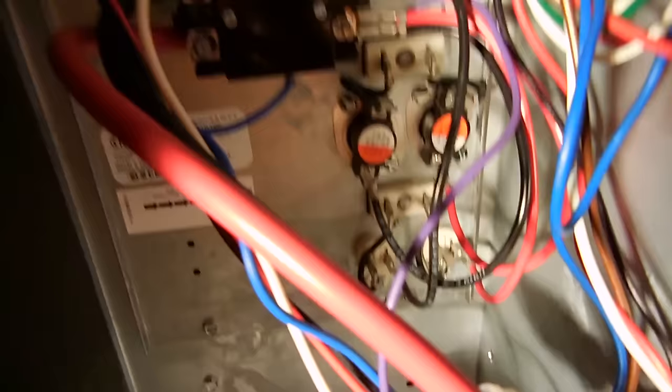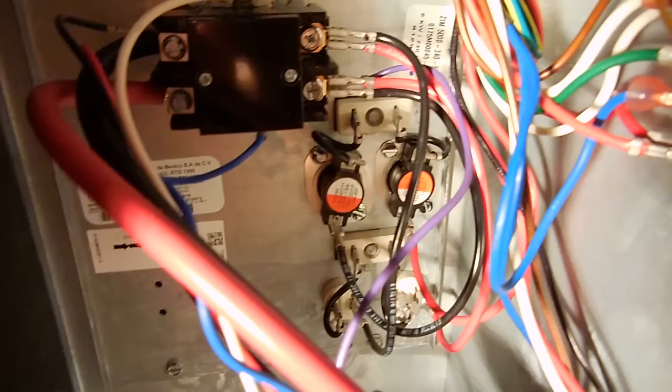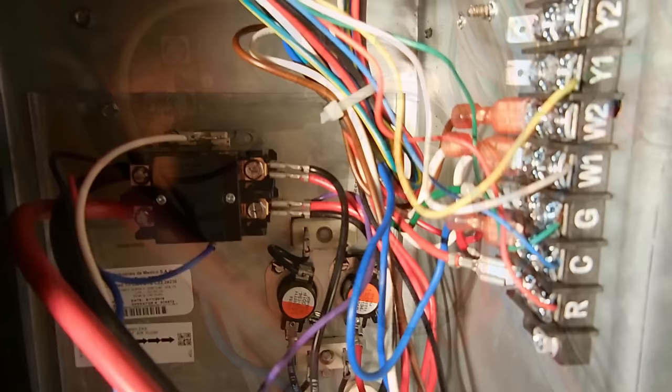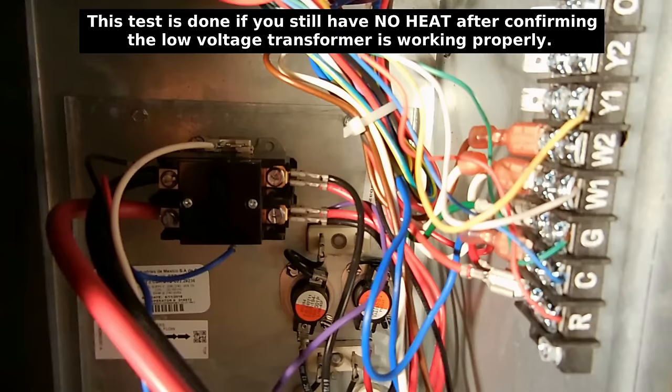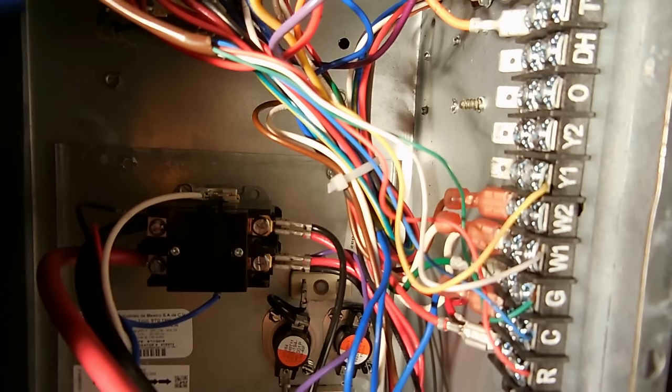A black and red wire on the upper pole, and a black and red wire on the lower pole as well — both go straight down to the ceramic areas where the heating element is mounted. The orange and black components on the left and right are thermal cutoffs: if it gets too hot inside the compartment — in the event the blower motor fails — the heating elements will turn off. You want to measure AC voltage between the white wire on top and the blue wire at the bottom, which is common, and make sure you have 27 volts when heat is turned on.